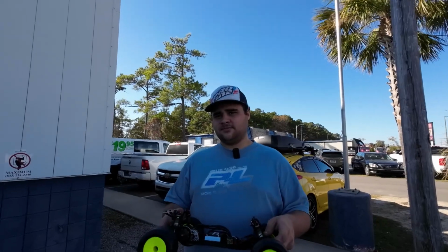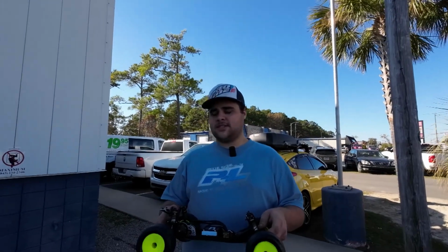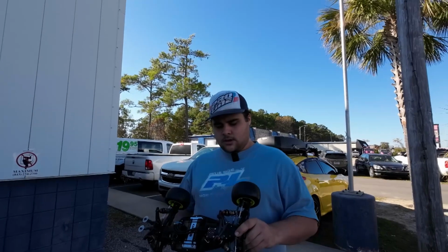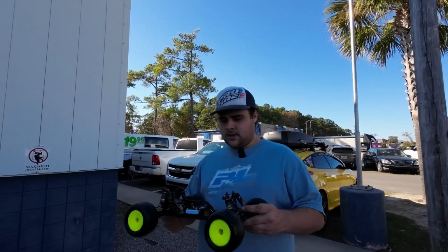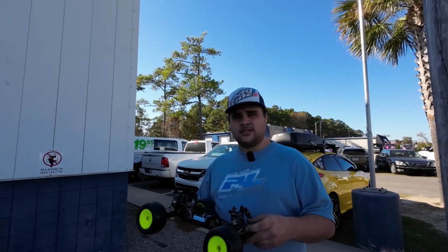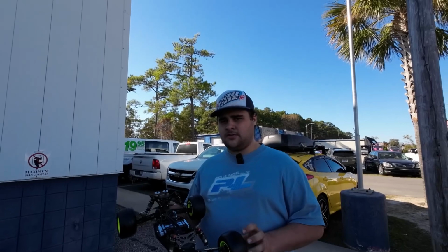All right, that's another question. Some people answer, some people don't. Okay. What is your tire prep? For slicks, I typically just sauce them and then I warm them for like 10 minutes. Sometimes I'll sauce them twice if the track's kind of loose or kind of green, just to get the tires in or if you need to break them in quicker.